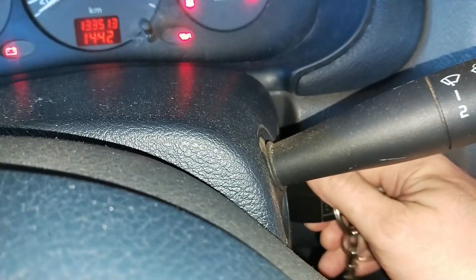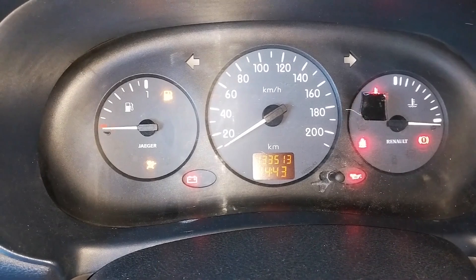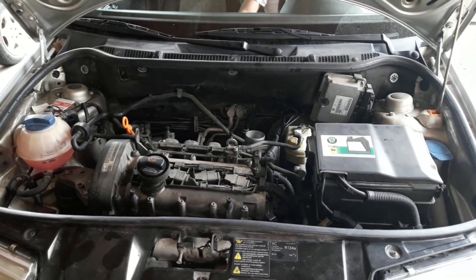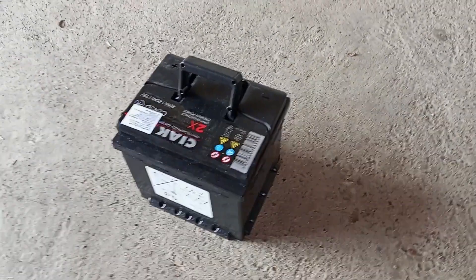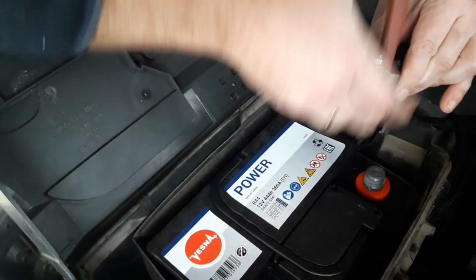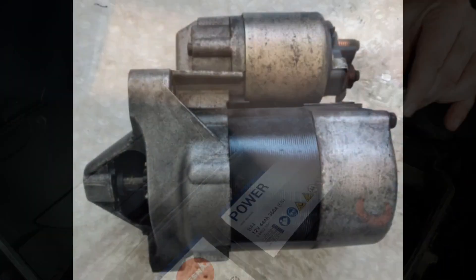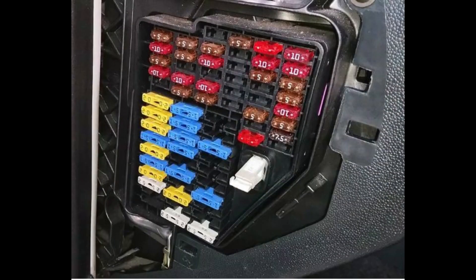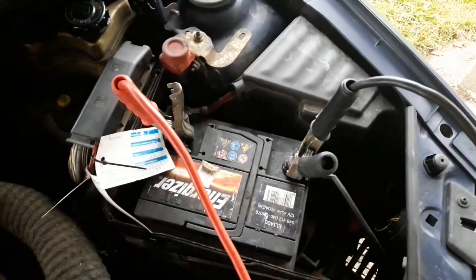With a no start, no crank problem, it is very important to make a good diagnosis. In most cases, the behavior of the dashboard lights will give a good hint of what's wrong. Take your time and have some patience when searching for the problem, otherwise you may end up paying for unneeded repairs. Lots of times people immediately change the battery, or even worse the starter, but in fact the terminals just needed cleaning — that's a couple of hundred euros or dollars out the door. So don't immediately go and buy new batteries, starters and other expensive parts. First check all the connections and fuses, use a multimeter if you have one, and try jump starting the car if you can. All of this is mostly free to do and will probably give you a good picture of what the problem is.